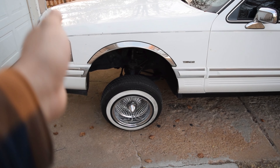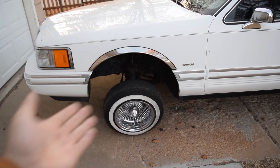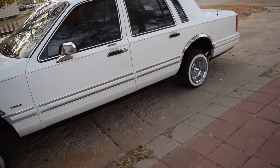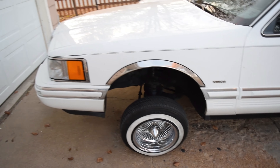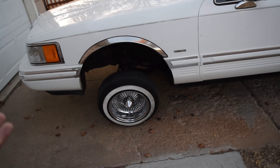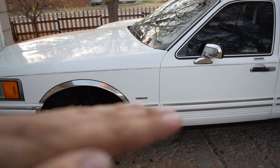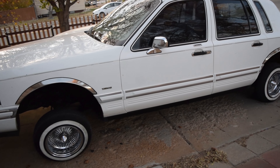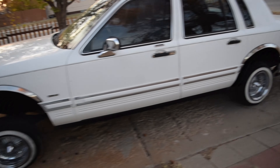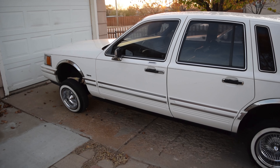I just wanted to give you guys an update on this and let you guys know that it really does work. I will say whenever I did it, I had the car positioned like this in the driveway. And I don't know if you guys are able to tell, but my driveway has a slight bit of slope. So what I did was after I drove it, I brought it back, reversed in, then drove forward and let the car settle — that way it would be more of a regular driving position. Because whenever you're driving, all the ball joints and everything kind of settle a different way whenever you go from forward to reverse. So whenever you come to park, the car rolls back just a little bit and it throws the alignment off.